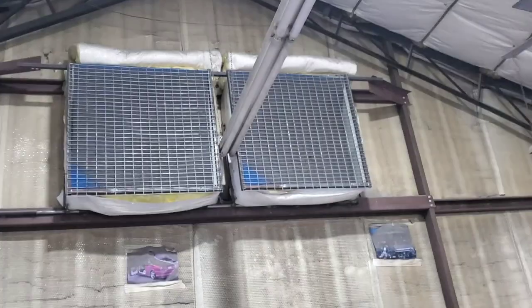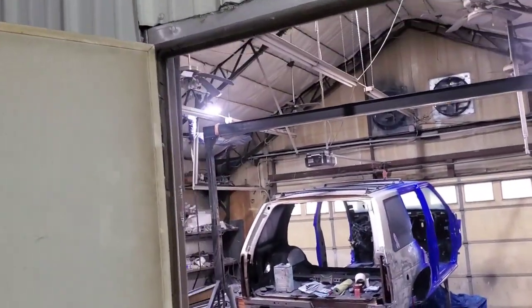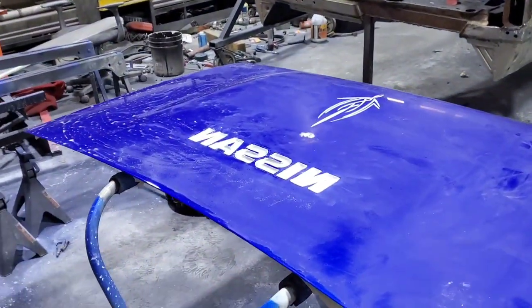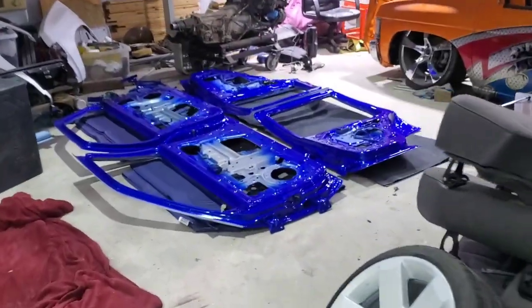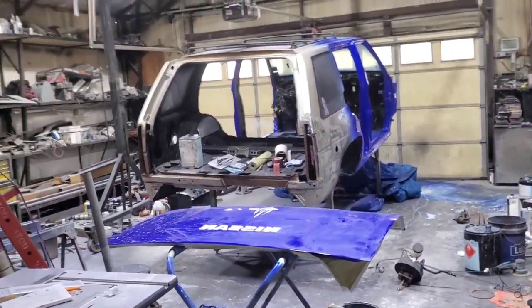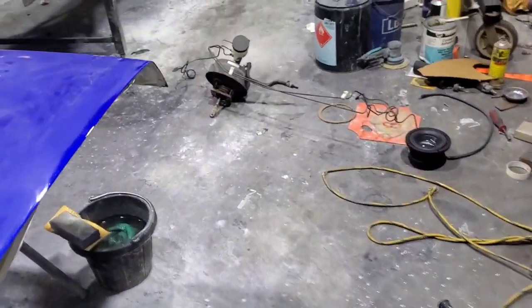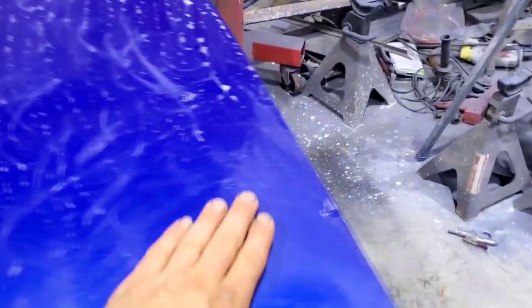My clear didn't work out like I wanted — I had some bugs and a little bit of trash. I think my trash is coming from my filters that are clogged up. This is a new addition on my shop, and what I was doing is rolling up the garage door, sucking air through my filters, and since they're dirty I think trash was falling straight down onto my hood when I was clearing. Some other pieces turned out really good but they were done more in the middle of the shop where the Pathfinder is now sitting. The bumper turned out really good too. It's gonna be super hot all week but I'm off for three days so I'm gonna try to get some of this stuff knocked out and some videos done.